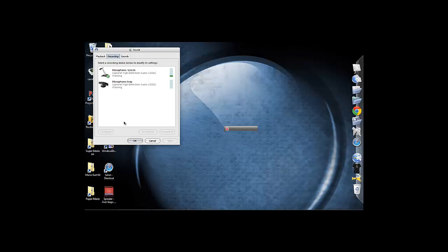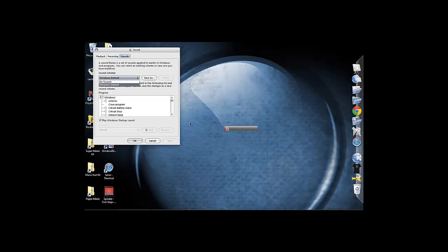You need to make sure that it's plugged into the jack for the microphone slot. If you put it in the headphone slot, it's not going to work. So we're just going to make sure the codec's working — it says working and it's ticked. And make sure that you've got Windows default on, and sometimes it won't come up in the mixer.